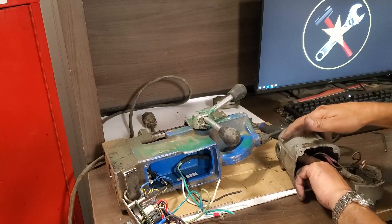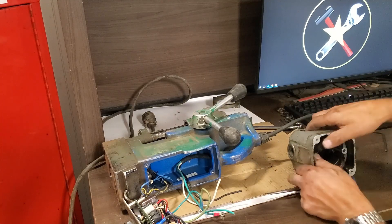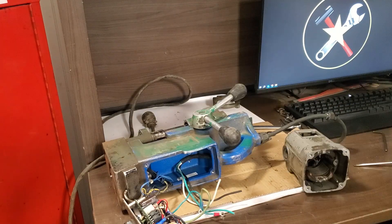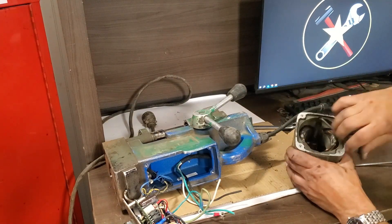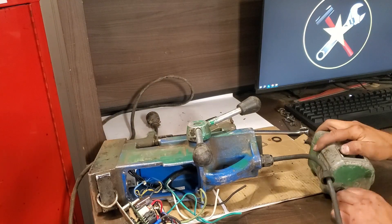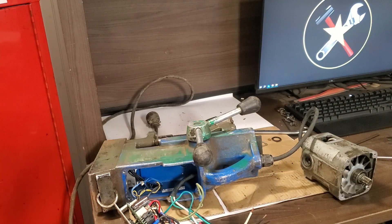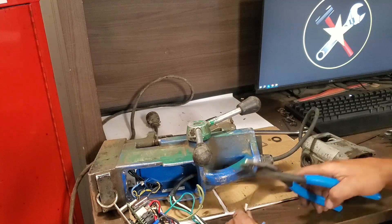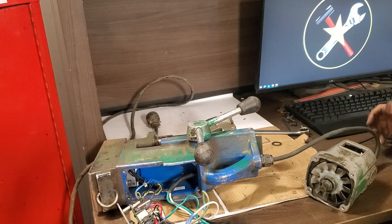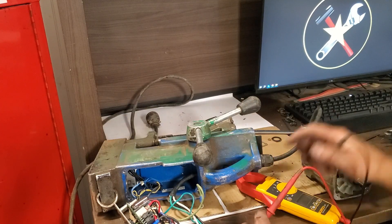With that testing good, I put the stator back into the casing along with the fan shroud, then I put the armature back in. Finally I tighten the strain relief and put terminals on the wires inside the case. With one last continuity test between the terminals and the brush holders, the cord replacement is complete.